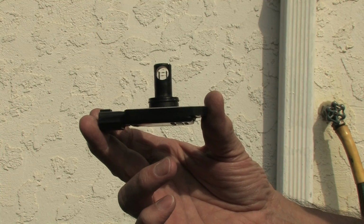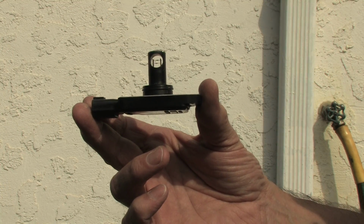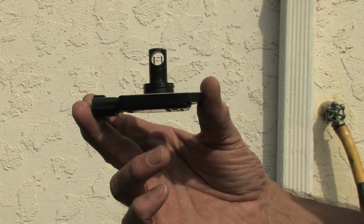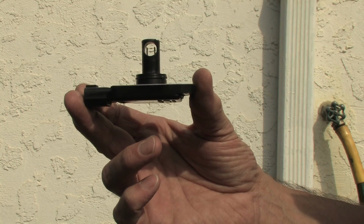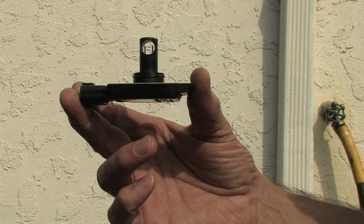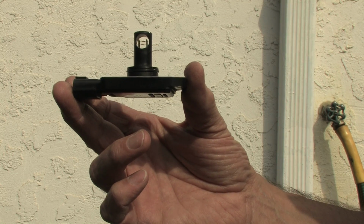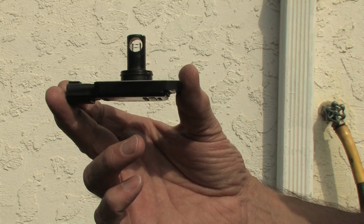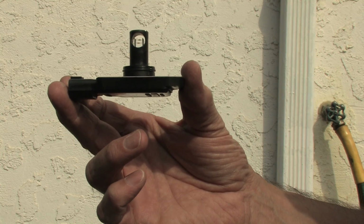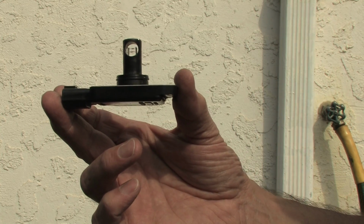You'll see it's got a hole in the center where the air passes over, and it has 2, they look like transistors in there, for those of you who remember what transistors are. And the air flows over that, and it's a whole complex way of doing things, but what it does is it helps control the mixture of air and fuel to provide more efficient burning. And if that isn't working properly, it'll screw up everything about the way your car engine runs.